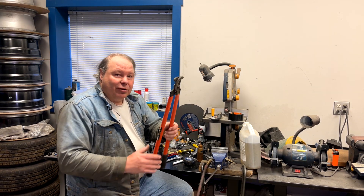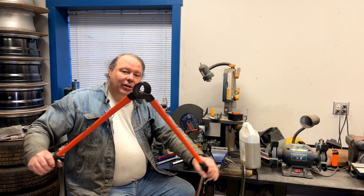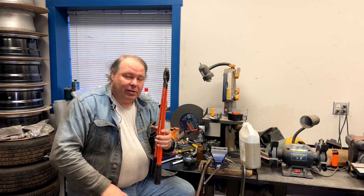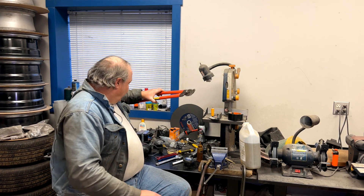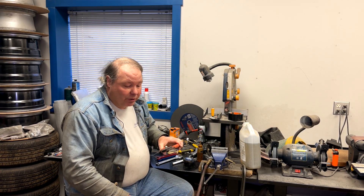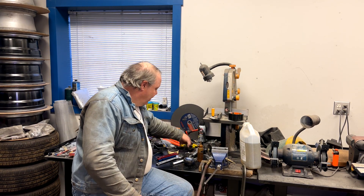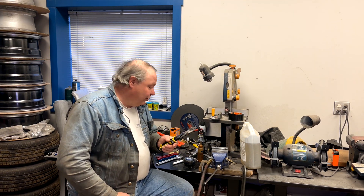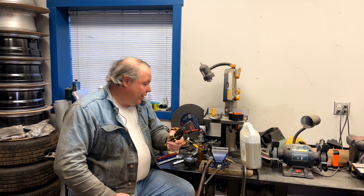One of the little secret tools you might consider is a pair of heavy-duty cable cutters like this, which can be very helpful for cutting the hose in tight places, places where you can't generate sparks, or where it's more important to keep the inside of the hose clean. Sometimes you also need some little shears, especially if you use the cable cutter, to just clean up the job at the end.